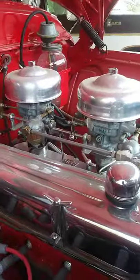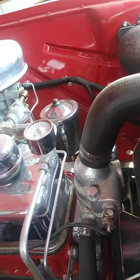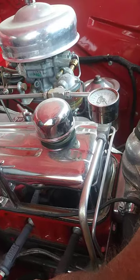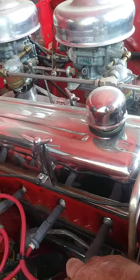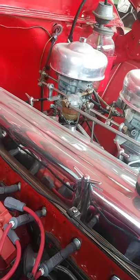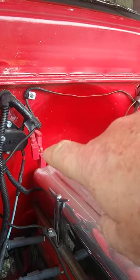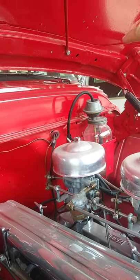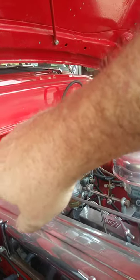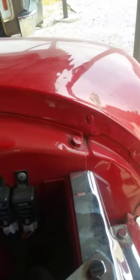On the motor, I had the valve cover and a lot of the chrome pieces chromed out. It's got new spark plugs — I think they're eight millimeter, but they're upgraded spark plug wires for the high energy ignition. I got new cables and I put ground cables all over the place so that we make sure we didn't lose the ground. This back here is for the lighting relay system so that my main power doesn't go into the firewall into the switch. The switch controls the lighting circuit out here, which gives me a lot brighter headlights than going off of the switch.